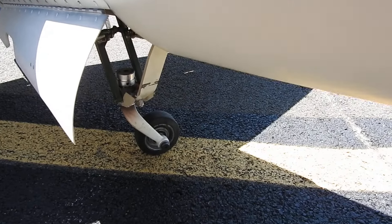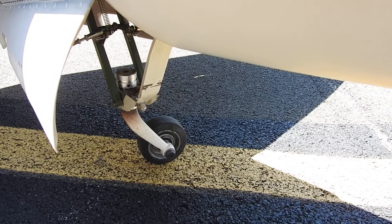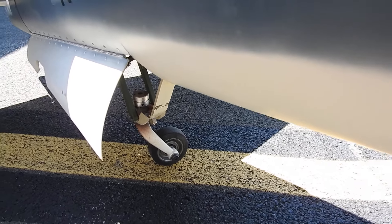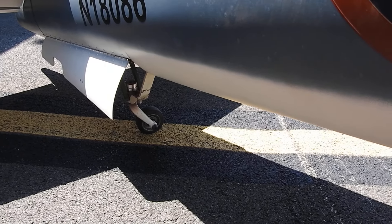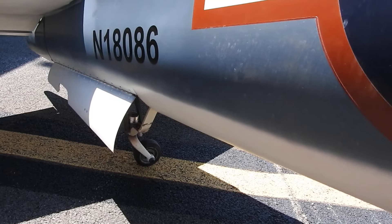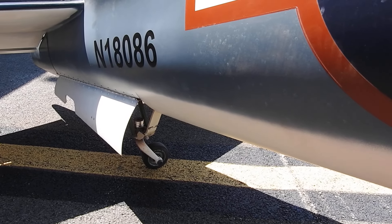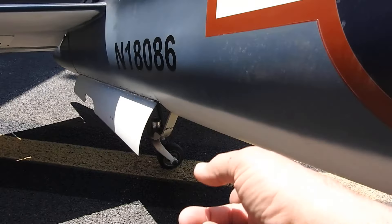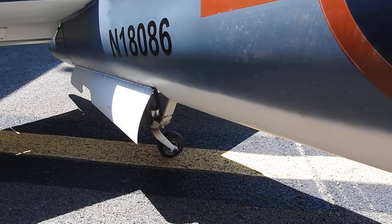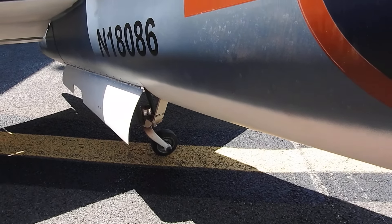The wheel is temporarily set up, but I'm going to order a six-inch wheel. All I have to do is unbolt that, pull that bolt out, put another bolt in with a longer bolt and wheel, put it back on, and I'm good to go. That'll just pick the plane up another inch — six-inch wheel, so an inch on the bottom, inch on top. I may end up propping the tail, pull those switches, or pull the wires on the hydraulic pump and cycle the tail wheel to make sure the bigger wheel clears that opening. But again, I have no issue with tail wheel shimmy — never had. Even at 50 miles an hour, nothing. It just runs true and holds good with my detent spring.